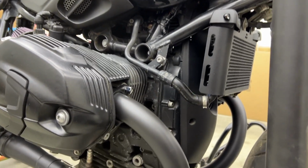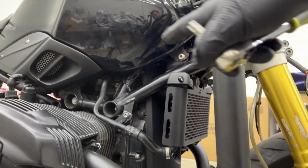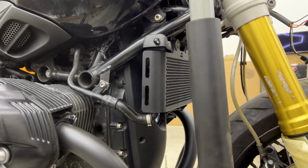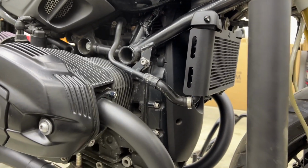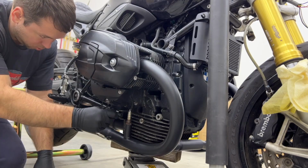I decided to put a drag under the engine because it's all frame bolts. So you loosen the rear frame, the lower one, and the main frame, one of the top ones. Shouldn't go anywhere because there's another one, but still it might tilt. So I just put a drag underneath just in case, and to not have any load on there.